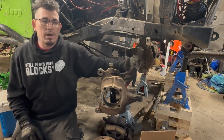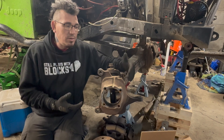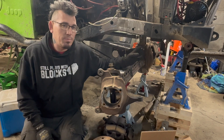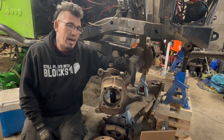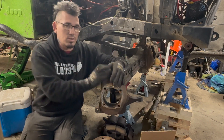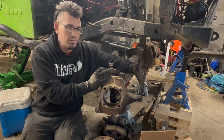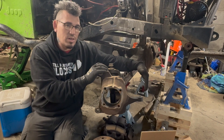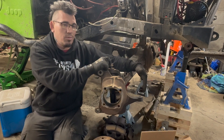When you're doing a swap like this, you need to make sure that your steering arm coming off your gearbox matches the distance that your drag link is mounted from the ball joint. For instance, the stock Super Duty axle had about a seven and a half inch mounting gap, so your drag link was coming off your tie rod, which is mounted about seven and a half inches from the center of the ball joint.